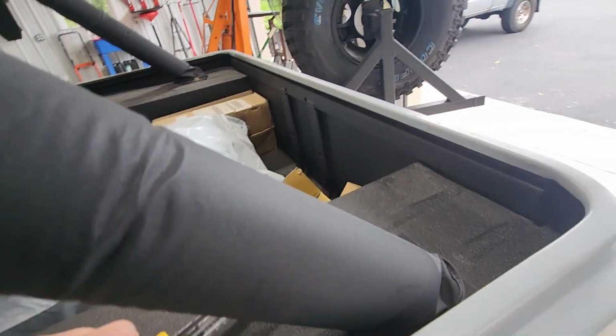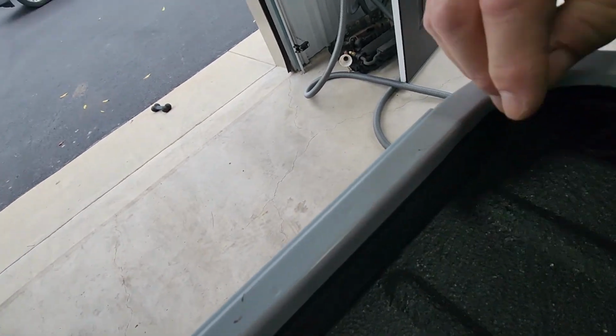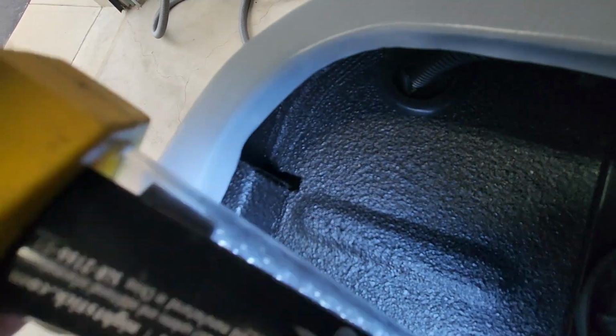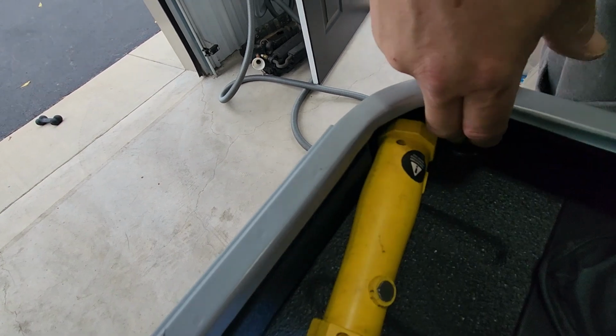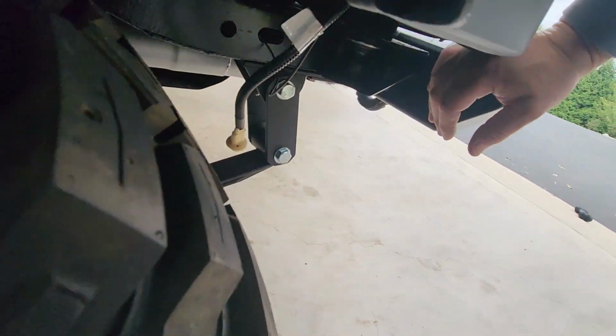Now, there is a grommet that comes on the rear harness. Unfortunately, I had already drilled the hole, and I drilled my hole to 1 3/8 inches, which was just a little different from the size hole that they had. Let me see if I can get the light in there again. There we go. But I had a grommet that fit right in there. Use that to secure it in place and to help try and seal it up a little bit.